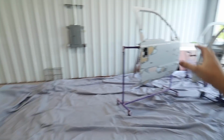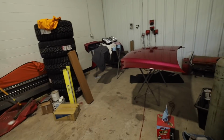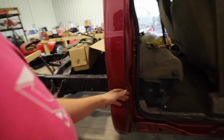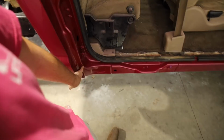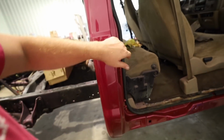And then, just to keep everything the same process, just like the hood and the fenders, we're gonna wet sand that primer so it's absolutely flat, and then we can come back with the sealer, the color, and the clear. But when doing something like this, just take your time, do it right. You want it to be as flat as possible, especially because we did all those steps here, there, and then down here, all this stuff was wet sanded, so that's how you get that smooth and glossy finish. If you don't do that on the doors, the truck's not going to match.